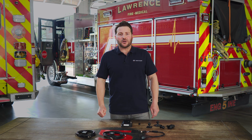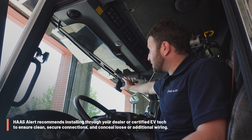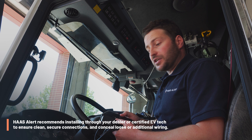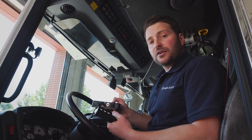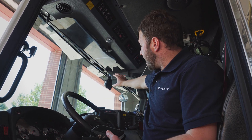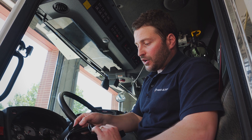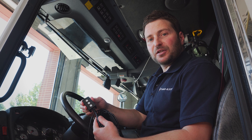Let's go back to Tiller 5 and take a look. On this particular truck, our HA-5 transponder is here in the center near the top of the windshield. The HA-5 could be mounted somewhere on the dash or somewhere else near the windshield. The first step is locating the HA-5 so you can connect the R-to-R kit. For simplicity, we have an installation done here. Since it's up at the top, we have the main splitter coming into the R-to-R port, which then goes to the RJ45 cable, which then goes into the LED indicator.